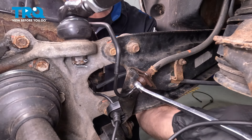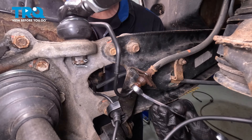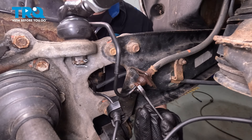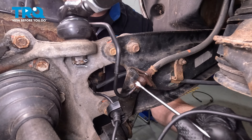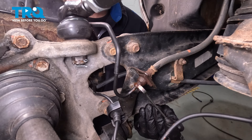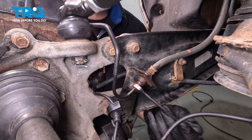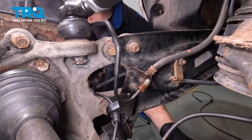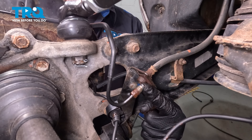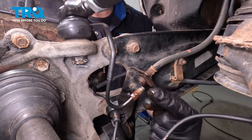I'll try to get my wrench on there. With it broken free, I can just use an open-end wrench now. A quick inspection of the fitting and the tip of the line — if anything looks like it's rotted and damaged, you definitely want to go ahead and replace it. This one looks fine, so let's continue on to removing the flex hose from the mounting bracket.